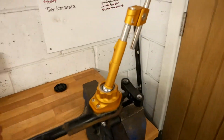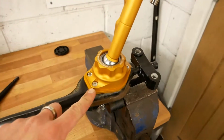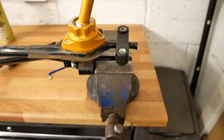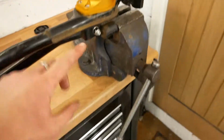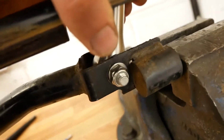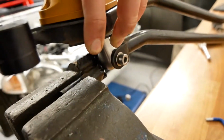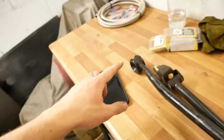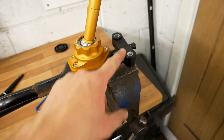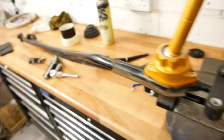So I had to whip out the standard shifter, which didn't take too long, drill out one hole, because this mounts with 3 bolts as opposed to the standard 2, just a little bit stronger. I did have to clearance the lower link a little bit, just because it was catching on this big teardrop shaped fella here, but it didn't take too much bodgery, to be fair. Also stuck the Energy Suspension bush in the one end and on t'other end as well. The bushes actually came off, weren't too bad, but certainly worthwhile upgrading whilst it's all off the car.